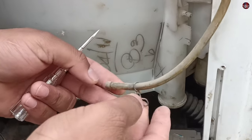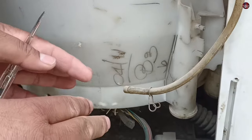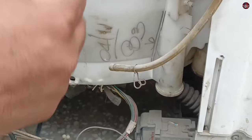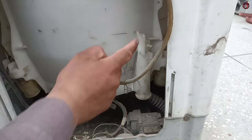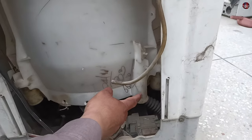This is how you will test the washing machine. After removing this pipe, test the washing machine. If it started to work normally, then this means that molds have blocked the air trap of the washing machine — the air trap will need to be cleaned. For that, you will have to open the whole drum of the washing machine and clean it.